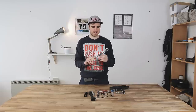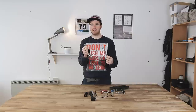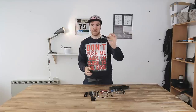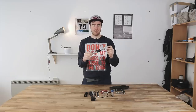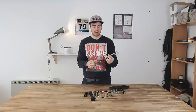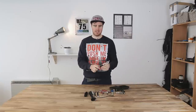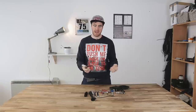One tire lever — with a little bit of practice you can change a tire with just one tire lever and something like a 17mm spanner. That's more than enough to get a tube in and get yourself out of trouble. Another nice tip from Dakar bikes: duct tape. Wrapped a little duct tape around a Motion Pro tire lever which also has a 27mm spanner on it — the same size as the rear spindle on our bike. If you can't find one where the tire lever has the right size spanner on the end, you can buy a steel tire lever, angle grind the end off, and weld on the appropriate socket.